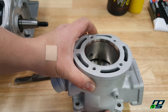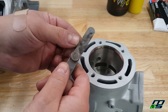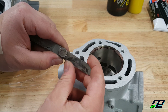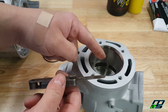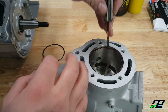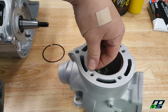All right, so there we go. And now that's our ring gap right there. Hopefully you guys can see that. What we're gonna do is take our feeler gauge. Now depending on what you're working on, you're gonna have a different ring gap. Typically, if you read most of the instructions that come with pistons, they say it's four thousandths of an inch per inch of the bore. So our bore is about three inches, so we want twelve thousandths. You measure that tiny little gap between your ring — and it fits, so this ring is good. This one clears.